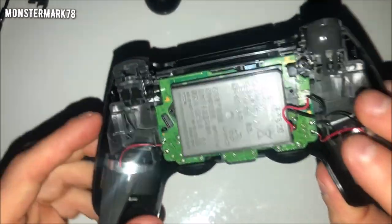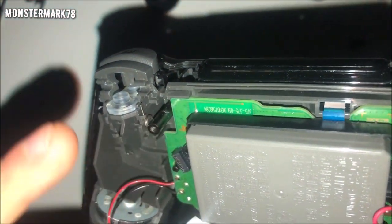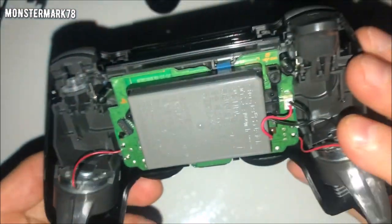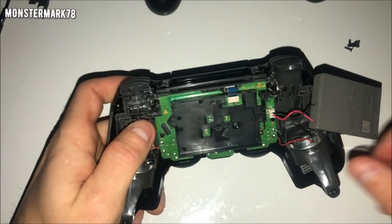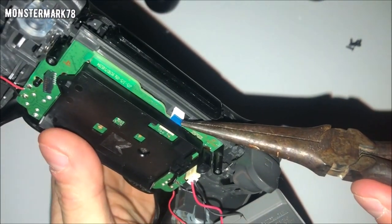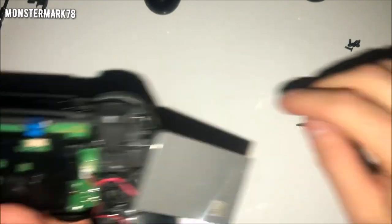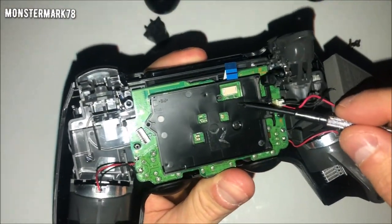Now for the spring. The reason you can't just pull the spring out is because a black plastic piece from the front is in the way — you have to pull that plastic up and out first. Move the battery to the side; you don't need to fully disconnect it. Then use needle nose pliers to pull the little blue tab out — it might take a few tries. Once you have a grip, pull it out. Then grab the mini screwdriver and remove the small screw.